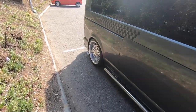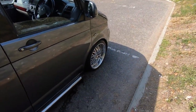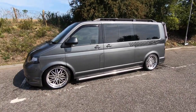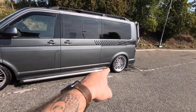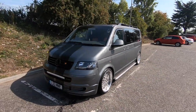I've been for a good drive in it now. I've topped up the water again — now all the air's come out of the system, everything seems to be working fine. I changed a couple of other bits as well while I was at it. I've found I've been scrubbing tyres so I've lifted the suspension up about 40 millimetres front and rear. It still looks quite low, but I had a bit too much camber on it because it was sat so low and it was scrubbing the inside of the tyres. So I've fitted some new rear tyres because they were worn out, given it a clean, and we're all ready to go again.